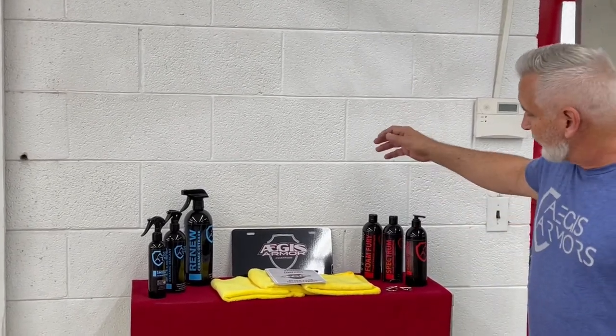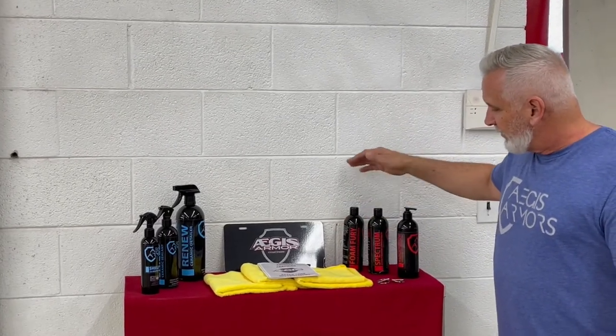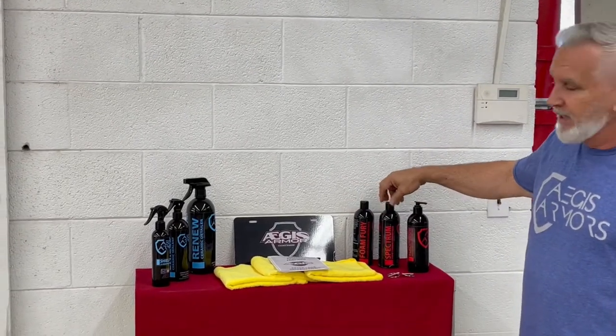Hey, my name's Frank. Today we're going to talk about the maintenance on these vehicles that we ceramic coat. This doesn't really just apply to our ceramic coat. Our products work on any car that's got a ceramic coating on it. Once a car has ceramic coating, you'll basically rinse the car every couple weeks. Then you'll take a foam can, apply our Foam Fury or our Spectrum, which is a ceramic-based soap, adds a little more gloss. Basically let it sit on the car for about a minute, rinse it off, take a leaf blower and dry it. No touch, no scratch.